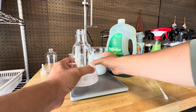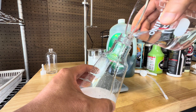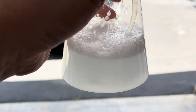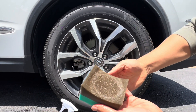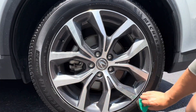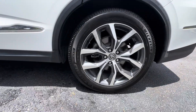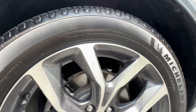Time to see how it works. Right now this mix is about 50-50 oil and water, which is similar to a gel-type shine. Let's water it down a bit more to make it behave more like a sprayable commercial product. Give it a good shake and go in with three sprays on the applicator pad, working it into the tire like you would with any off-the-shelf product. Three more sprays and continue working it in. Now that it's been about 30 minutes, you can see the water has evaporated and we're left with a thin, consistent layer of silicone oil.